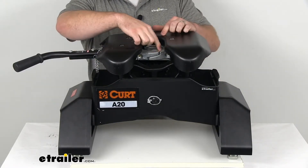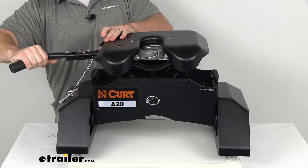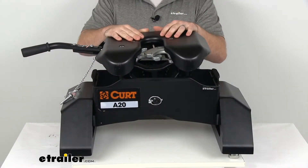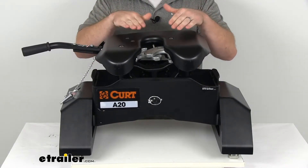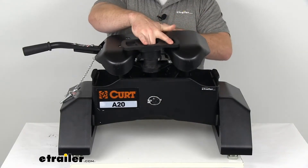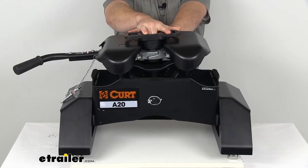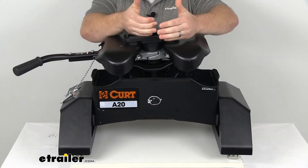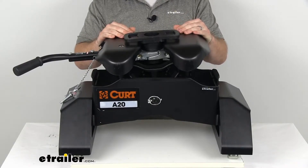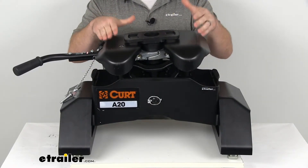On the front, we do have the interlocking jaw system. If I undo this pin, pull out and pull back, you can see those jaws coming apart — now they're ready to be coupled. So we just open it up like that, and then we'll be ready to back our truck up to our trailer. I have a model kingpin here so you can see how that process works. As you back up to your trailer, that kingpin pushes back into the jaws and they slowly close around it and lock into place. That jaw system gives you 360 degree contact, so it's going to be a lot more secure than your slide bar models that just slide into place. This is a really nice design — it's going to give you a lot less rattle and more security.